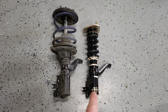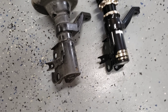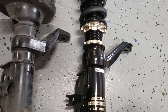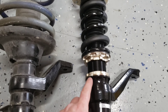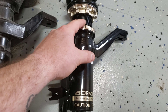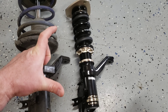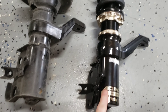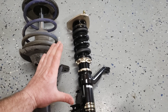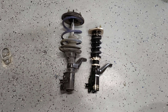I'm not trying to slam the car — I really want to keep roughly the same height. We're going for about a one-inch drop. The way coilovers work: there's a sleeve in here with perches you can unlock, which allows the body to screw on or off the sleeve. That extends or shortens the overall height of the strut — that's how a coilover works. I'm going to unlock these perches and extend this assembly out to raise it back up, getting it closer to the length of the other side.